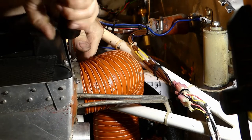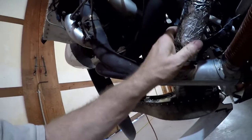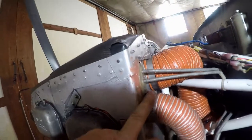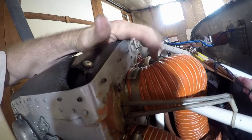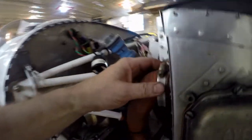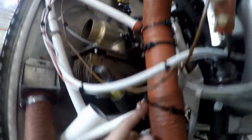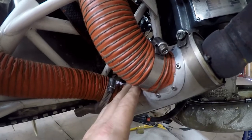That's completely dry — no leaks there at all. Nothing. This is all buttoned up again. We're zip-tied to the frame here, to the starter cable, to the frame again. Three-inch scat going to the oil cooler. Here's the passenger heat air intake — tied to the frame, holding the cable secure. Tied to the frame, down to the exhaust muff, and then into the cabin heat for the passenger. Over here is the other end of the three-inch scat going into the oil cooler.